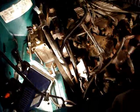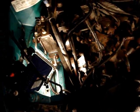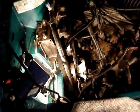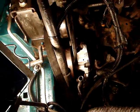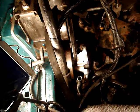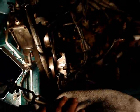And I was thinking, well, I've seen a lot of leaky water pumps, but I've never really seen one leak so bad. And I'm probably wrong. There's probably some other chief mechanics out there who'd say, oh yeah, that's pretty common, but you wouldn't think it would run out as fast as you pour it in through the water pump weep hole. The seal in the water pump must be bad, but that's what it did. Man, I was thinking cracked block, blown head gasket, leaky frost plug.